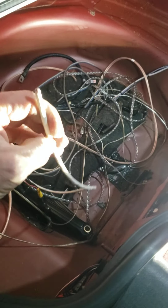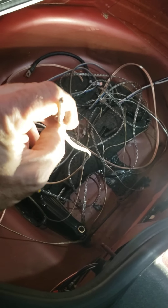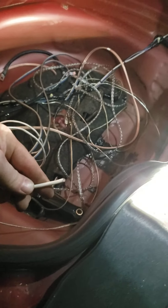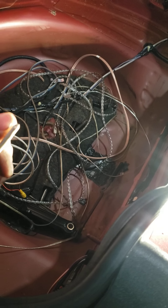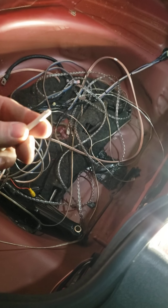It'll be nice and discreet — won't look like it was totally hacked up. With this reverse camera and this multi-conductor wire, there's a wire that comes off of your radio. I attached it to one of these — one of these is going to get tapped into your reverse lights, so when you go to reverse and your reverse lights power up, it'll send 12 volts to the head unit.